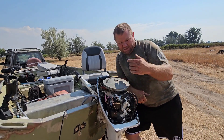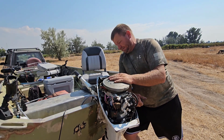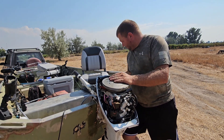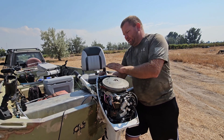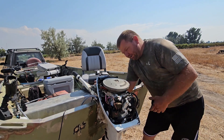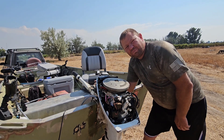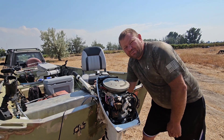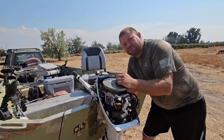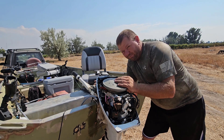I shut the camera off, pulled the spark plugs, and did a little diagnosing. We had a bad case of 'chinesium' — the made-in-China CDI didn't work out. So I'm going to have to contact them, put the original one back on, and my boat motor runs like a top. Sometimes you luck out with a cheap part, sometimes you don't. I'm going to contact the company through eBay and see if they'll send me another one. Thanks for tuning in everybody — I hope this helped. Please like, comment, and subscribe.